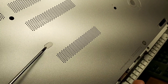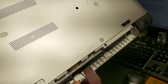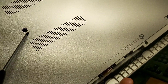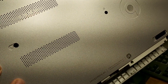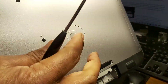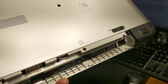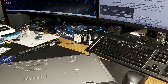There's a little tab here — you're gonna stick something underneath it to get this piece off. Inside this cavity there is a captive screw, which means you will unlock it but it's not gonna drop out of its socket — it's held in there by a special retainer design. You need to unscrew it several times. Once you're finished removing all the screws in this machine — I think it's about 26 or 27 — I'll show you where the others are.